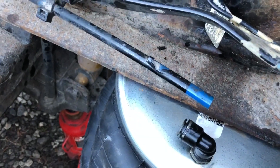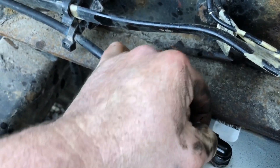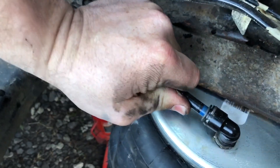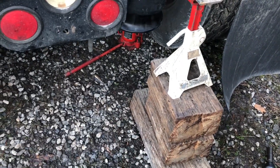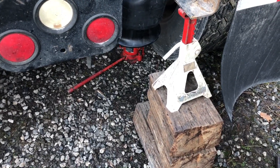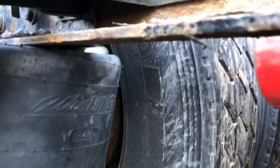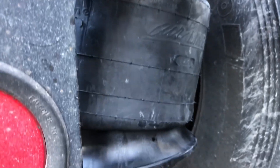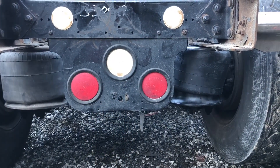You see how that's lined up pretty good with the airline — now it's time to put the airline in. All I'm going to do is simply push it in as far as I can — give it another final push in — and that's about it, that simple. Next step is I've got to take the truck back off the jack stand and jack. I'm just going to jack the truck up, pull the jack stand out, and then just lower it. I've got the jack raised up, tires off the ground, and as you see I don't have very much play between the frame and the jack stand — the airbag is pretty well compressed down.